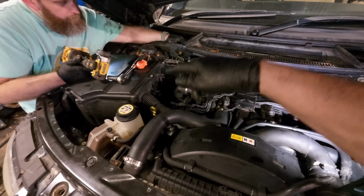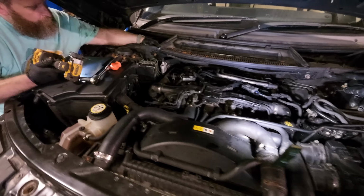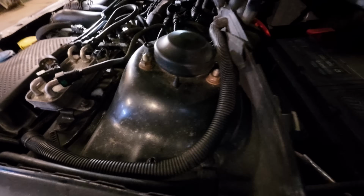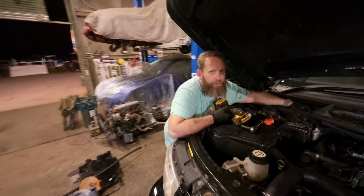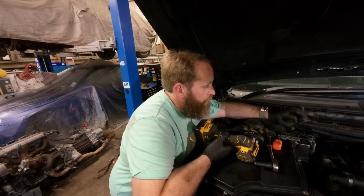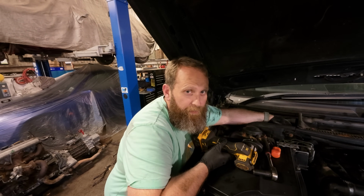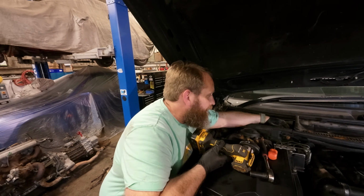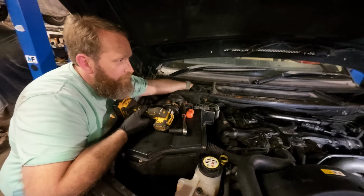Liam has resorted to a Birmingham screwdriver because these have, in the back, a little, what would you call it? Well, it's a recess that the bolt sits in, and normally you wouldn't have to have a spanner on both sides. It would hold the bolt for you and you can just undo the nut this side. But the nut's rusted solid, so somebody's tried to undo it before, presumably, and rounded out the hole. So now we can't get anything on it to hold the... This side just nudged out a bit, didn't it?